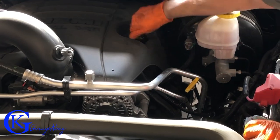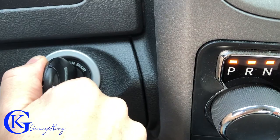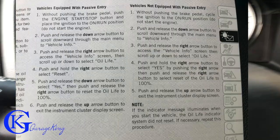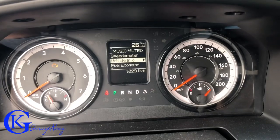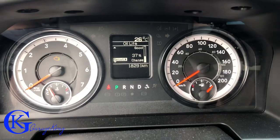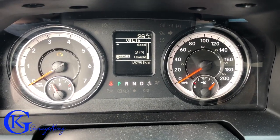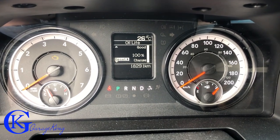Okay, so I've done my checks and the oil level is good. So time to reset the light. Now to reset the oil light, you're just going to turn your ignition to on but don't start the vehicle. Then you're going to go down on your steering wheel just to the pads. You're going to find where it says vehicle info right there. You see a reset button and then you just go to the right and you push it and you have to actually hold it. Then it'll confirm — you can see there it just changed. It is now 100%.